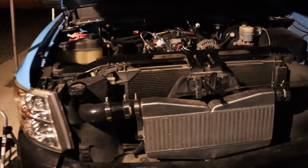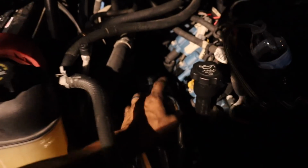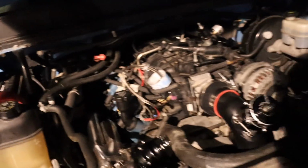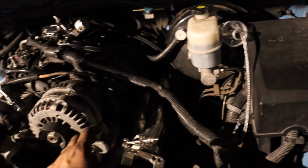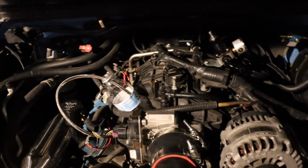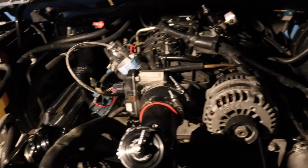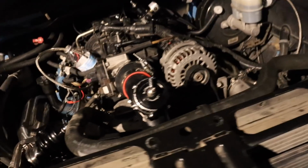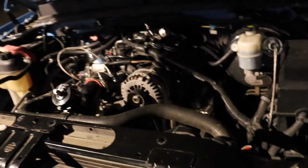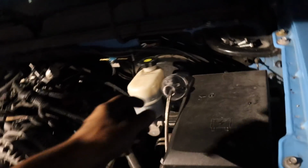All right guys, quick update. I got the oil dipstick in already. Kind of struggled a little bit, but it's in already. And I got the turbos out and the oil feed lines and water bottles so I can see if there's oil pressure coming out. And whatever's inside the header is just gonna blow it out. So we're probably just gonna turn it on for like 5 seconds or so, or until oil starts coming out, and then we'll turn it off.